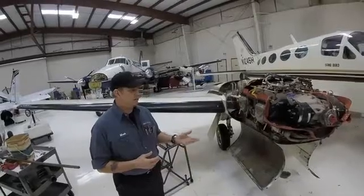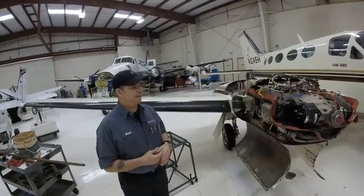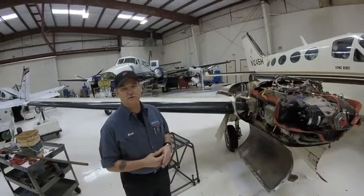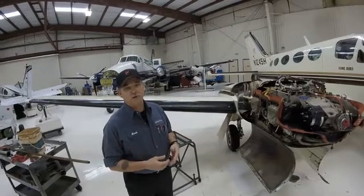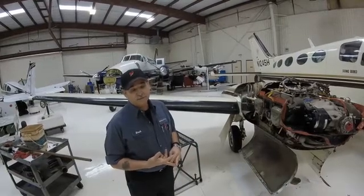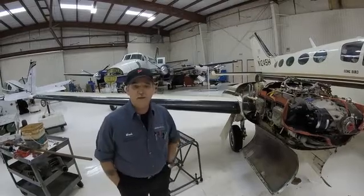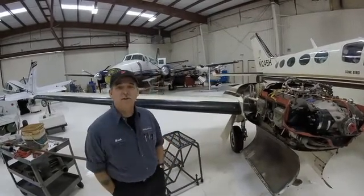For the most part the engines run fairly well, but that metal wearing — if there's a defect on either surface of any kind, they're just going to sit there and grind each other apart. So inspecting the oil filter on the oil change, maybe doing oil samples, will show you that metal is being eaten up in that engine. You'll see that as iron in the oil.